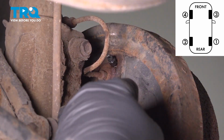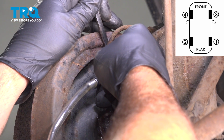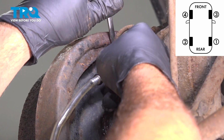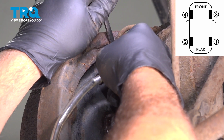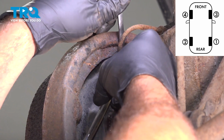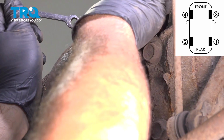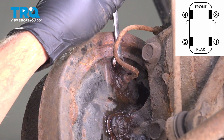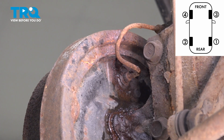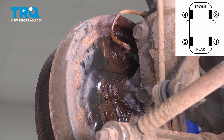All right, let's go over to the driver's side rear. All right, go ahead and pump it up. Holding. Floor. Okay, pump it up. Floor. All right. At this point here, pop off the drain port, make sure this is snug. Give that a spray with some solvent to clean up some of that residual brake fluid. And then let's move to the right front.